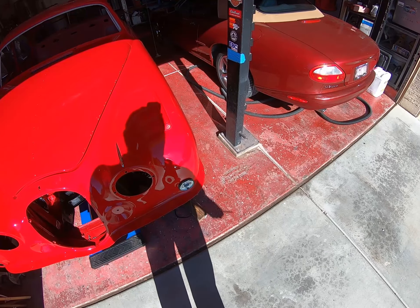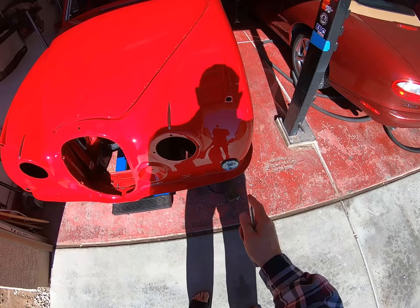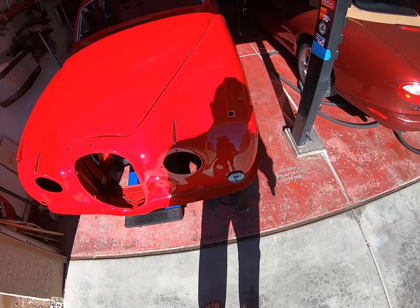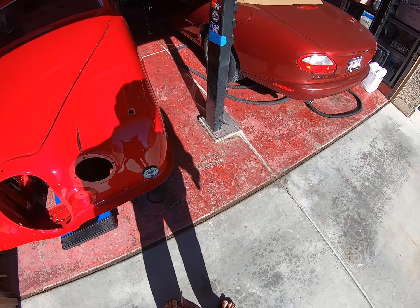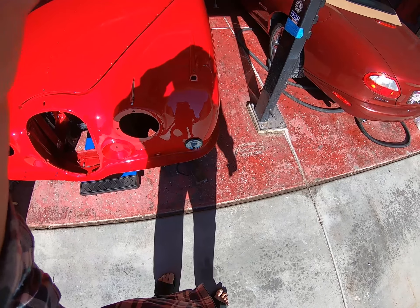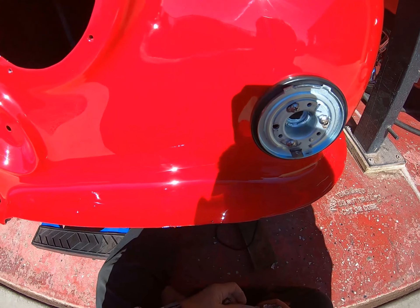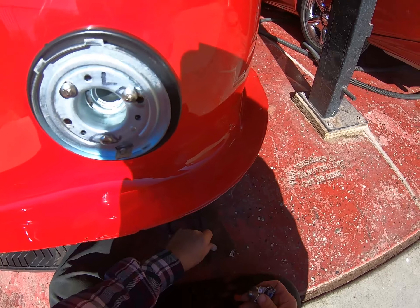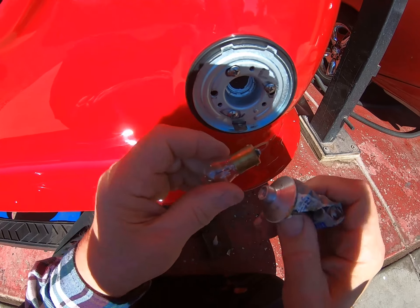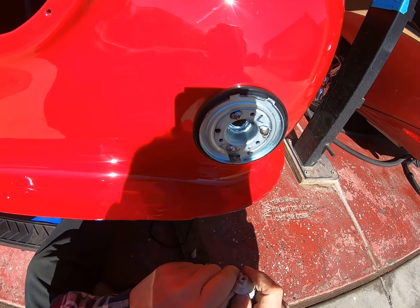When my parts arrive there's one more seal to go on here. I'm waiting for that from S&G Barrett, and that probably won't be till midweek next week if I'm lucky. One final little piece of advice you may or may not wish to note: dielectric grease on the bulb. Helps prevent corrosion.